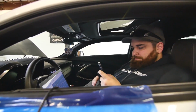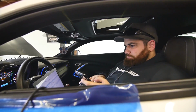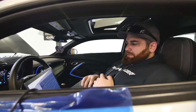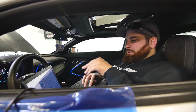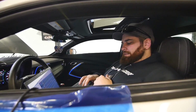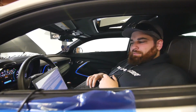All right, that's a new one here on the Race Pro Motorsports YouTube channel. Still picked up really good power from just tune only. Picked up like 9 horsepower and 11 torque on E, but it's only adding 2 degrees of timing. I actually changed it so it would just add more timing without adding more E right there, and it didn't pick up any more. Before it was only adding like 1.6 or 1.7 degrees of timing. But that's what it picked up. Have a nice day, everybody.